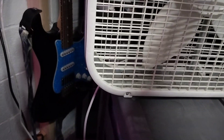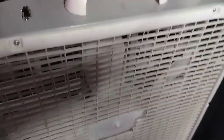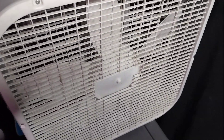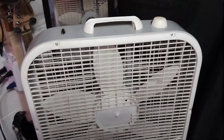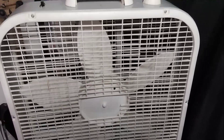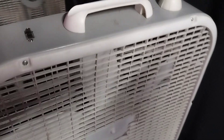This one had the usual blown thermal fuse for no real reason other than it got a little warm. It's just got a normal 3733 motor in there. Now, I should probably disclose that you should probably not do this. I don't really recommend that you run the fan in reverse, but I have run this fan for about an hour with no issue. However, if you do decide to take this project upon yourself, do so at your own risk. You should probably be okay as long as the thermal fuse does its job and blows, which it probably will.